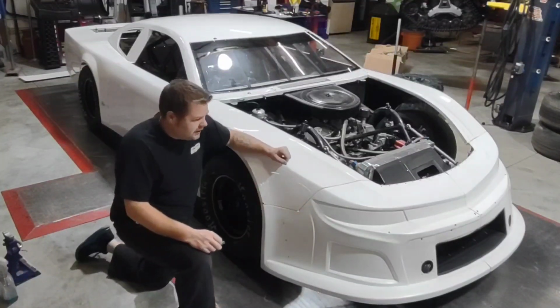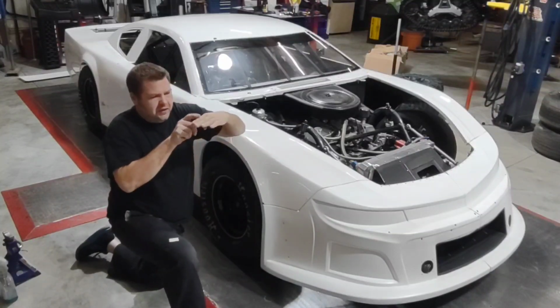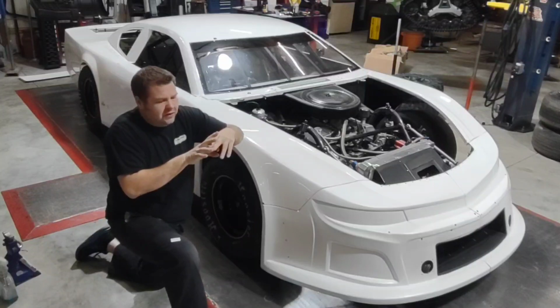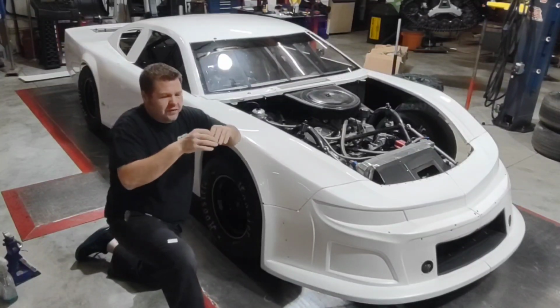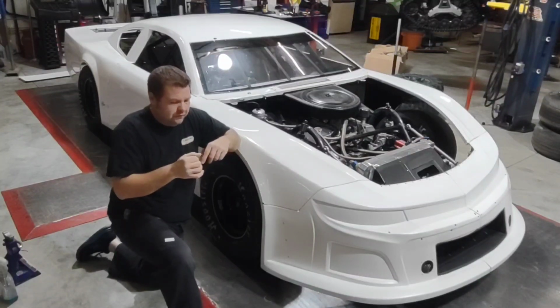I'll show you a couple little techniques that I use to get some of those pits out. If you don't try to remove those pits, you've got this flat surface that has a divot, but it's not really a divot. It's actually a divot with a couple raised sides on either side of it. If you don't find a way to smooth those out, then all of a sudden you'll have either a bubble or just a lump in your wrap. Yeah, they'll be small, but there'll be thousands of them.